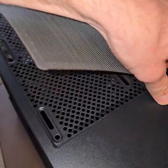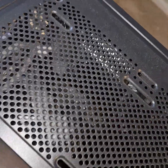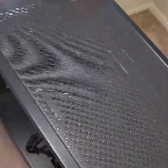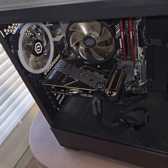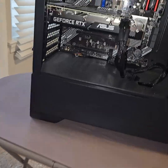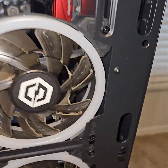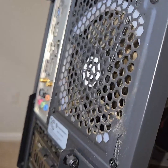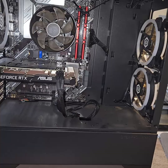Up here is a filter as well. I'm gonna take this off and wipe it down. Under it can still be dirty, so I'm going to blow it off. Never wipe your PC down with moist wipes, never get moisture in or around it, and never wipe it down with a dry wipe either — it can cause static electricity. Right now it's okay, it's not bad. This was after two or three months of not cleaning it, so you might want to clean your PC regularly. I'm gonna put it back together.